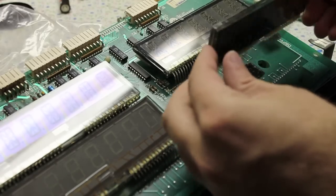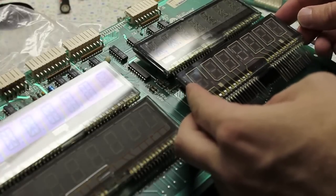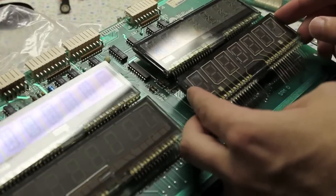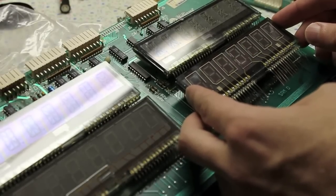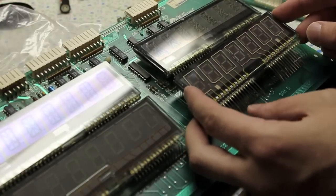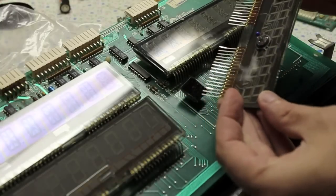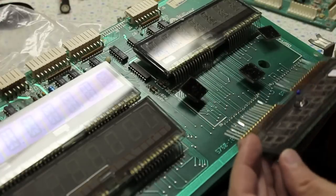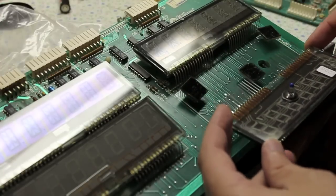Today I'm trying to work on replacing the display in Space Station. I got this new one from Pinball Life, but when you try and get it close, it can't get close enough to the board to mount against the standoffs, and it also places it a little too far away for these contacts. The reason is there's a small nipple on the back of the display from the factory on these replacement ones, which doesn't line up with the hole that comes in the board.